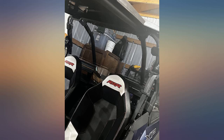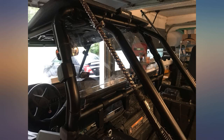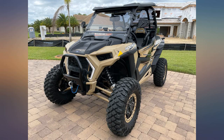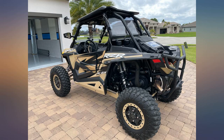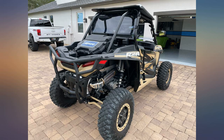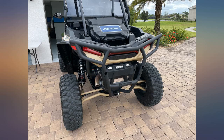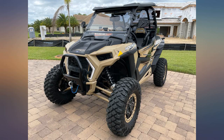This rear poly windshield fit our XP4 1000 perfectly. Adding a windshield to the front creates an eddy effect where wind and dust enter the cab from the rear. By adding the back window, this reduces wind and dust, and definitely helps reduce cold air in the winter. It's easy to put in and take out. After initial install, the weather strip is probably the most difficult part. Recommend having two people for that part and using a small rubber mallet to seat the weather stripping on the window edges.